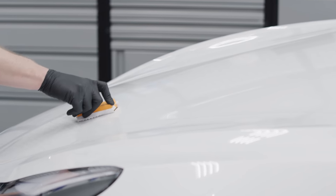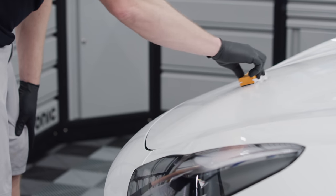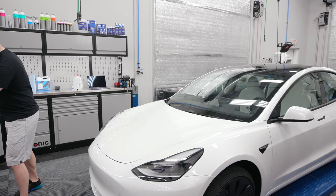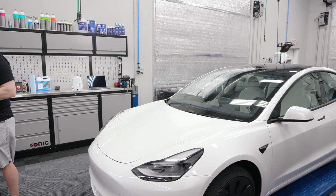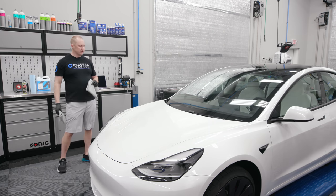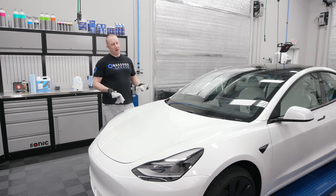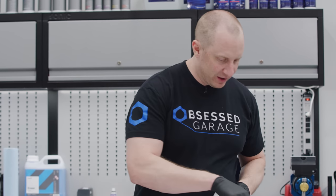I find that a cross-hatch pattern works well for both EXO and CSL. With CSL you're going to wipe quite a bit more — when you do Crystal Serum Light it comes right off in like half a wipe in two seconds. You might pick up some dust from the car sitting overnight, but as long as it's not heavy dust it doesn't matter. Take your towels — you can mark them if you want, I try to keep them somewhat organized. You'll probably need about four towels to do the EXO process. EXO is quite a bit thicker than CSL.